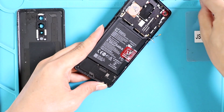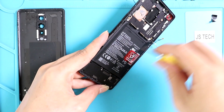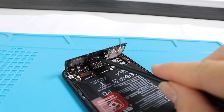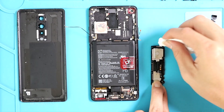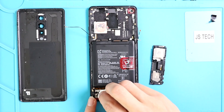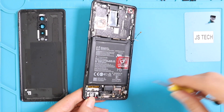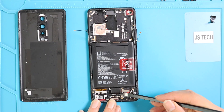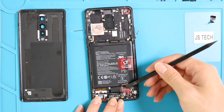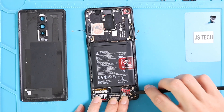Okay, now we can move to the lower bottom section where the charging connectors are. First, undo all screws and remove the top bracket that protects the PCB. It looks like the bracket comes with the ringer attached too. Again, there is some more moisture — let's clean it off. Anyway, I am surprised to see the water, but the phone is working fine, so I hope it will continue after the teardown as well. Let's take out the small PCB board, disconnect the flex cable connectors and antennas, also the flex cable on the left hand side.